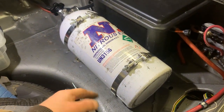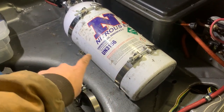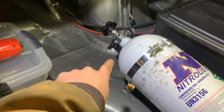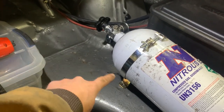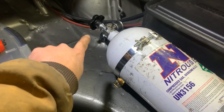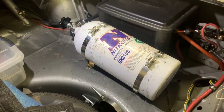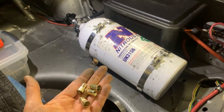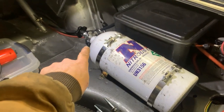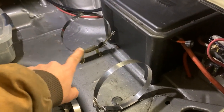What I'm going to do is put in some nutserts so I can just tighten the brackets to hold the tank in place. I can't go straight down because that's where my rear rail is, so I'm going to put it right over in that general area closer to that little contour, and then run it to the front of the vehicle. I'll go ahead and drill a few holes — hope I don't hit anything — pop these nutserts in, put those brackets in, and drill a hole to run the line.